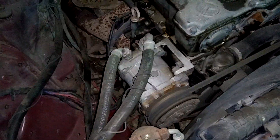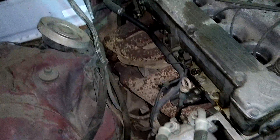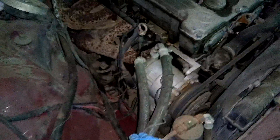As I mentioned, it's got sand in the compressor. It's a Euro car so it's got the dual manifolds — 3 and 3. I think I did replace the plug wires as part of this whole process, so the plug wires should be pretty good. The compressors are sanded, and one of the hoses is so dry that I did try to add a little bit of freon to see what it did, and it basically just leaked out. So you'll need to replace the hoses.